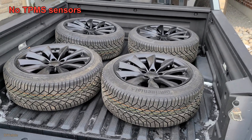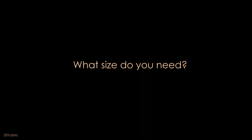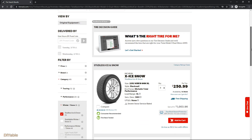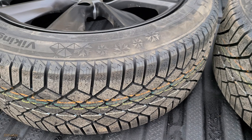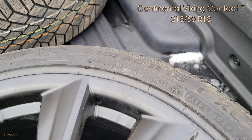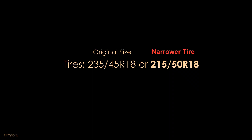This is the new set of winter tires I got. The first question is what size of rubber do you need? For Tesla Model 3 Long Range, you can use the same configuration as the summer tires: 235/45/18 inches. But if you ask anyone living in an area with heavy snow, they will tell you to go with narrower tires. For me, I got the Continental Viking Contact 7, 215/50/18 inches. Of course, Tesla fanboys will argue about this — I am not gonna go there.